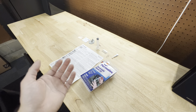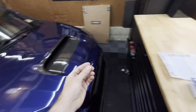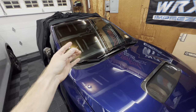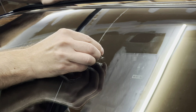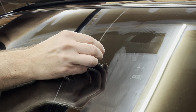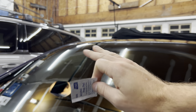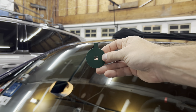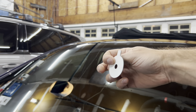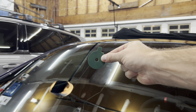I figured I'd give it a try and see if it turns out well. First things first, let's take the little safety pin that's included, scrape out the hole, and get any debris and residual glass out. Now we're going to take the alcohol prep pad and wipe the area to make sure there's no dirt or grime — get a nice clean surface. Next step is to take the adhesive sticker, peel off the white side first, and place it over the hole.